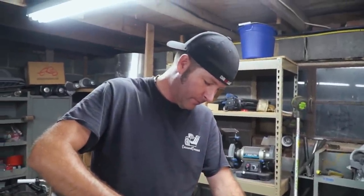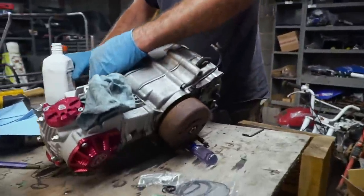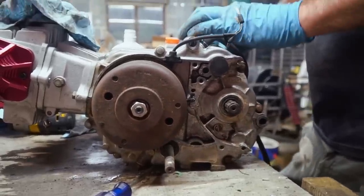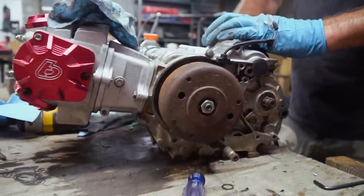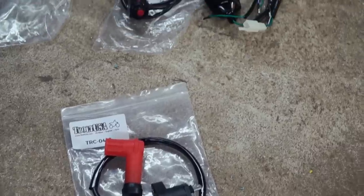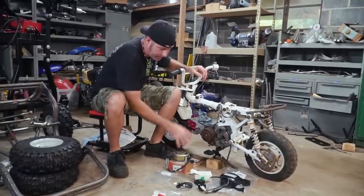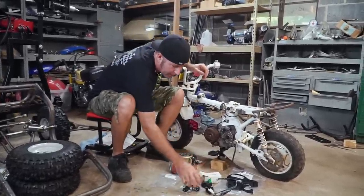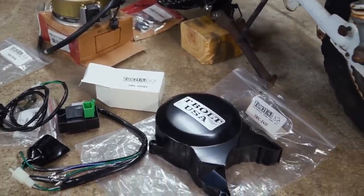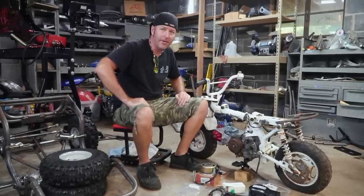Ike's filling it up with oil so we can spin it over. The factory charging system and ignition system is looking really rough — we have a stray wire just floating around. We're going to try to kick it over and see if we have spark, but we are not hopeful. It's been a couple of days — T-Bolt USA sent us all the parts we need: a new charging coil, stator, flywheel, new CDI box, wiring harness, kill switch, coil, and a cool T-Bolt USA side cover. We also got some seals.